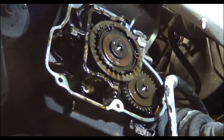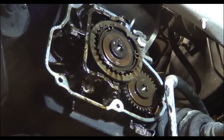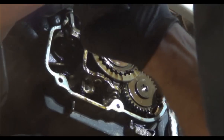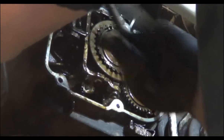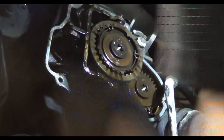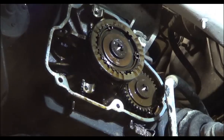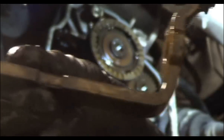Hopefully you could see that move out as I put it in fifth gear — I did that under the hood by grabbing the shift linkage. This bolt is a Torx 45. I'm going to take that off, move it out of fifth gear, and out with the bolt and out with the shift fork.